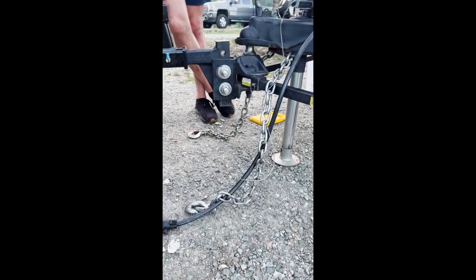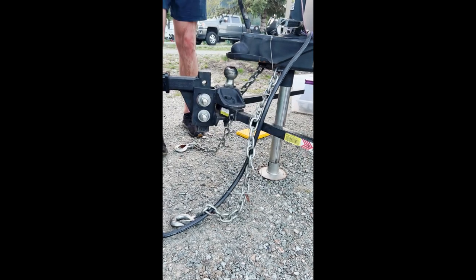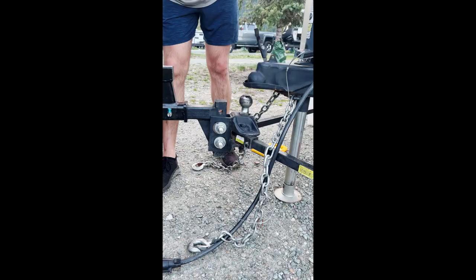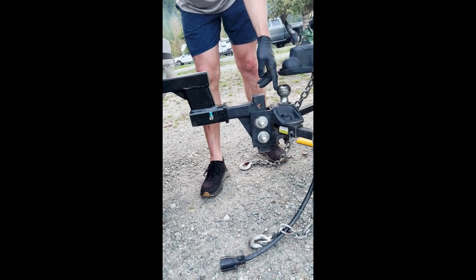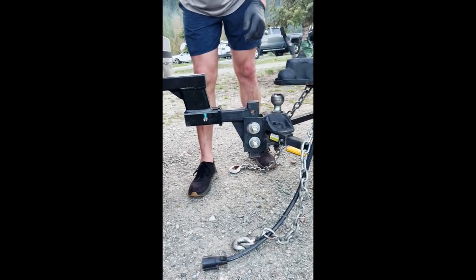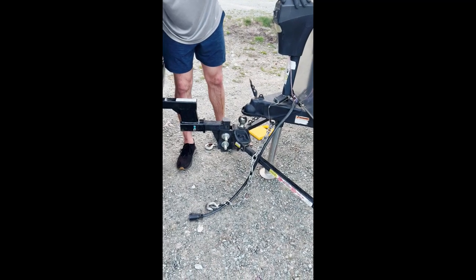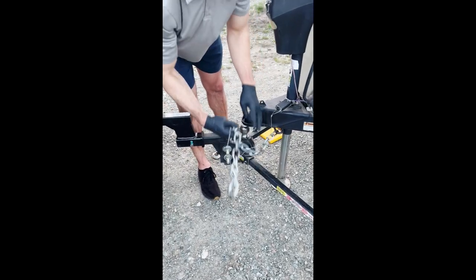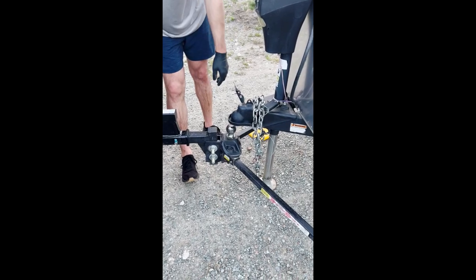If for some reason the car is starting to lift up, make sure that this pin is lifted all the way up so that it can release off the ball. If for some reason the car has shifted at all, or you've shifted the trailer during the setup process, the trailer kind of shot off the ball a little bit — that's just because the trailer had shifted back a touch and the car had not gone with it so there was some tension. Make sure that your fingers are out of the way. Now we have the trailer standing on its own, so we can store the cord, lift the chains off, and now you can see that the tow vehicle can be pulled out.